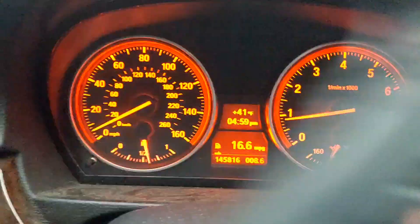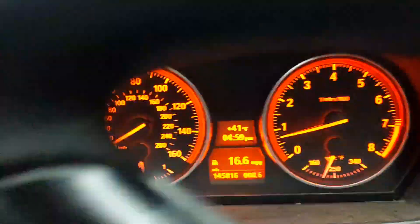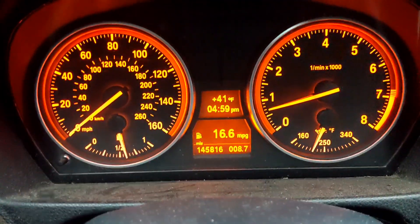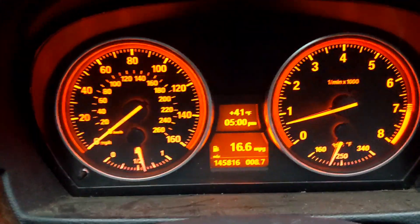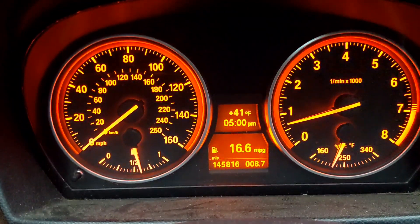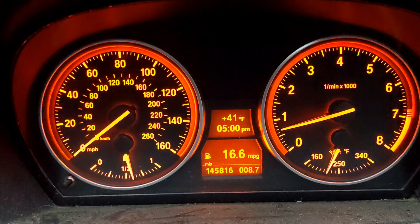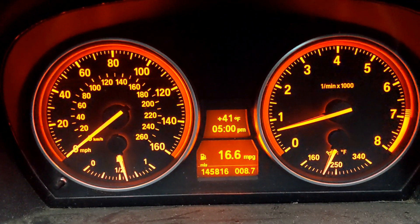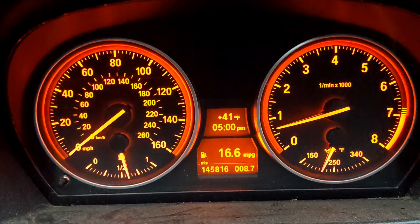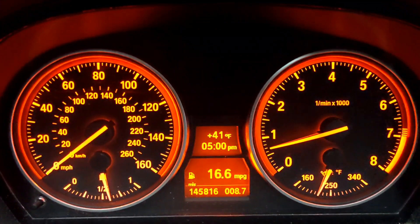The other error I had was my direct injection pump — barely made it home last week — but that's not part of the subject matter here. If you've had wheel speed sensor issues and the triple error codes, give the wheel bearing a shot. Sorry to be the bearer of bad news — it's not the easiest job, but it's not too bad if you've got the right tools. Hopefully that sorts somebody out who's struggling to figure out what's wrong. Good luck.